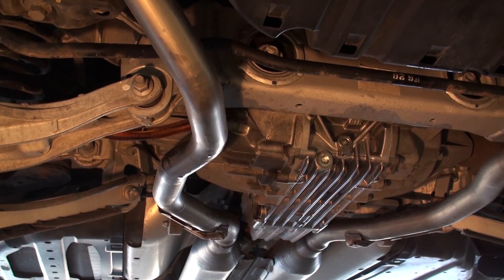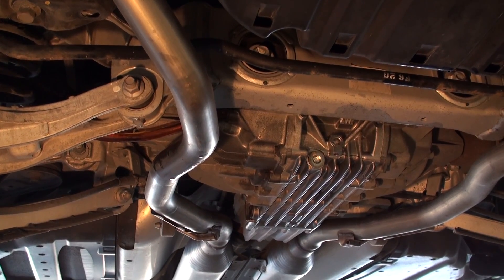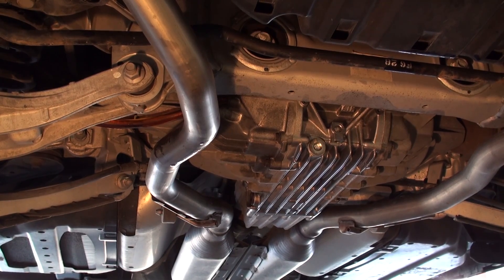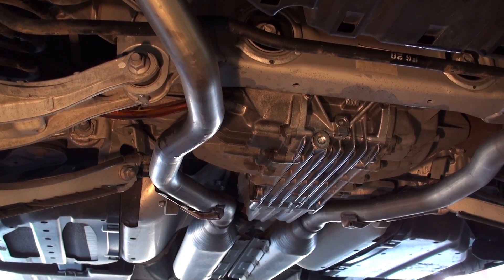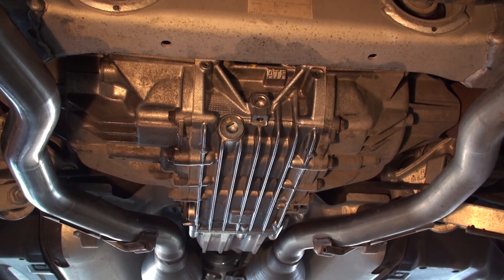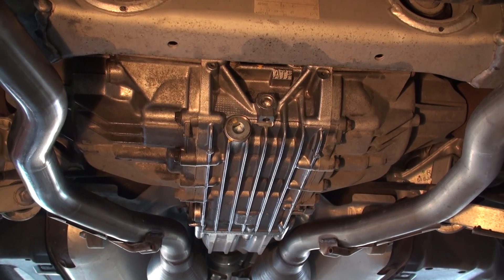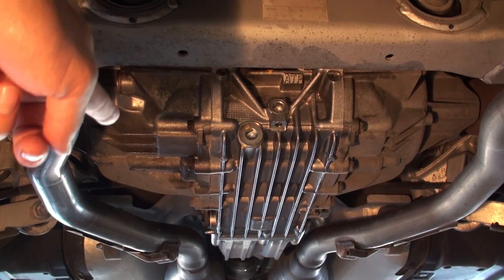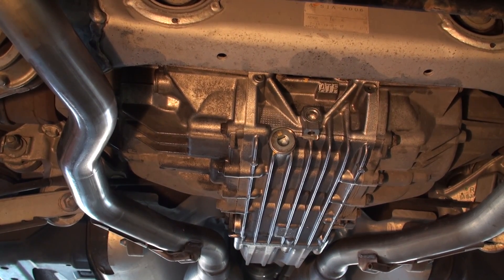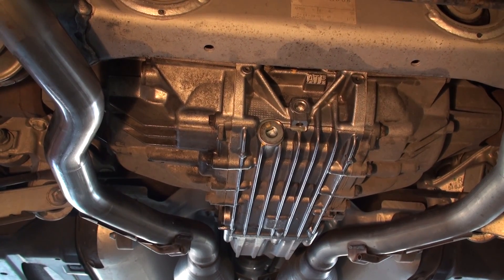We've already installed approximately three liters into the clutch assembly case and there's actually no oil leaking over the fill hole, meaning we haven't quite hit the complete full mark. Be aware that with the vehicle jacked up on the rear driver side, the case is tipped at an incline so you can probably fit a bit more oil than specified. As long as you've installed 2.7 to 3 liters into the clutch assembly case, you'll be fine. To recap: we've used four liters of Acura DPSF fluid — 0.7 to almost a liter in the hypoid gear assembly and about three liters in the clutch assembly. We replaced the two drain bolt washers with new ones, torqued them down hand tight, and of course tighten the fill plugs accordingly when done. I hope you found this video useful and informative — don't forget to rate, comment, and subscribe.